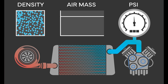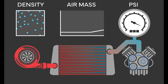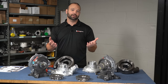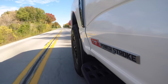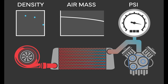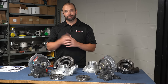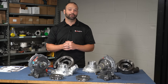Why is it important to control charge air temp? If you control charge air temp, you can control boost. If charge air temp gets out of control — say, instead of 150 degrees Fahrenheit it goes to 220 degrees Fahrenheit — that's a different amount of air, and the boost system cannot deliver the target air mass as requested by the ECM. The ECM is requesting a certain amount of boost pressure at a certain load, so the engineers might have said: we really need all the air we're asking for — we can't have inconsistency. So we need to cool that charge air, either via a supplemental charge air cooler, or cool the compressor cover and use it as an intercooler. That's theory one.